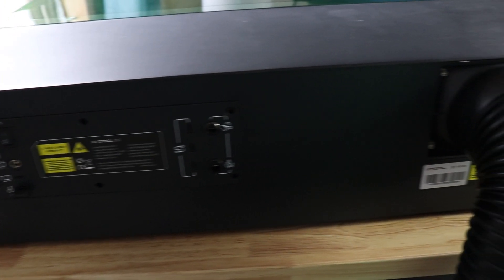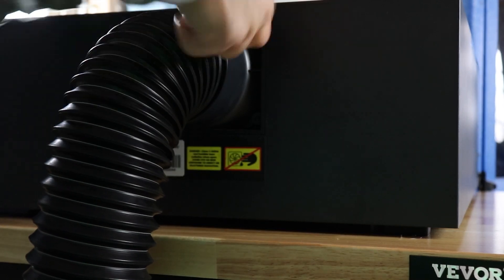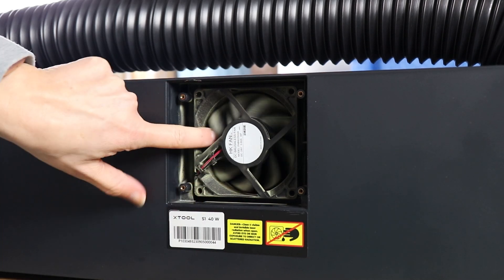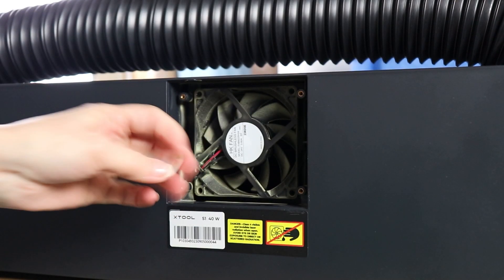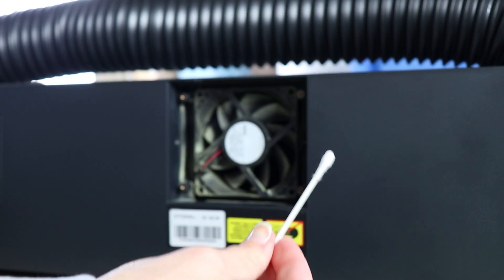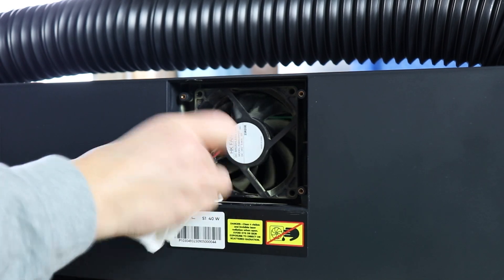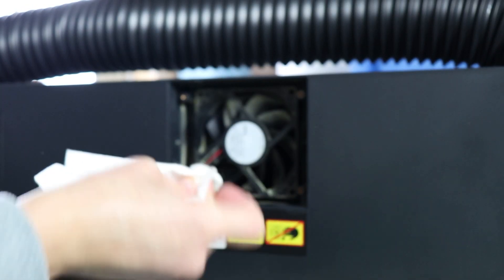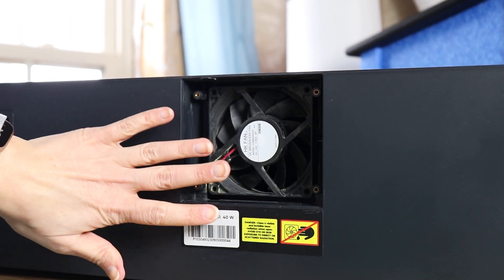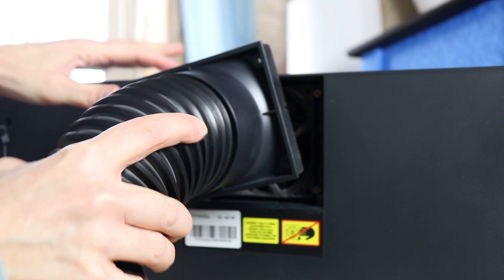On the back of the machine, everything is unplugged. We've got our vent hose right here, and I'm just going to unscrew these four screws to pull the hose off. This is a pretty dirty fan in here — there is a lot of dust, especially from wood. We are going to use a little bit of rubbing alcohol and a paper towel. You can also use a Q-tip to get into those little spaces. This alcohol is going to dry pretty quickly, but I do want to make sure there is no dampness left in here before I put my cover back on.